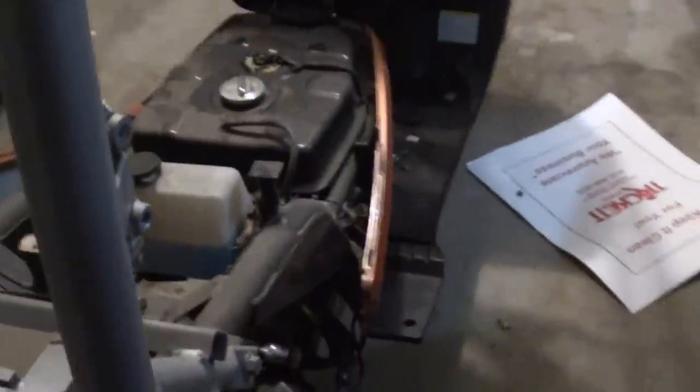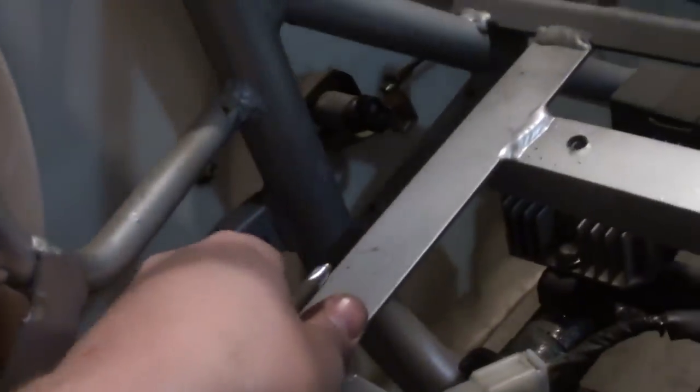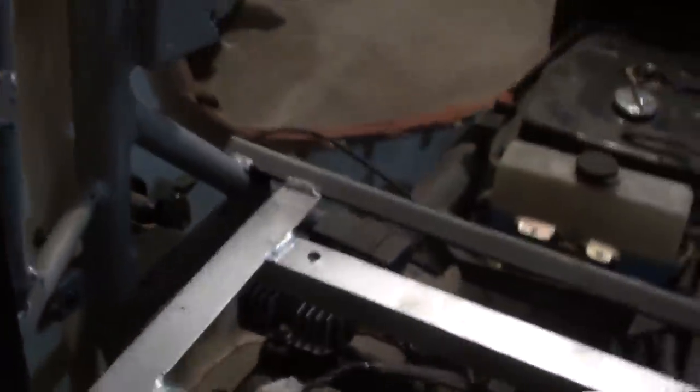This side section actually came off fairly easy — it really is just two screws holding it. You have one here and then a bigger screw down here. I removed the right hand side first, and now I'm going to remove the left hand side. On this side you have the lock mechanism, so it either has to be disconnected at the lock, or I will probably just slip this pull tab and pull the lock out of the side panel, because I have to have it out to paint anyway. It's just one small nut on the back to remove the reflector. Two screws pull out, and then you have two sliding clips, so watch those and make sure you don't break them — they just slide forward and out.